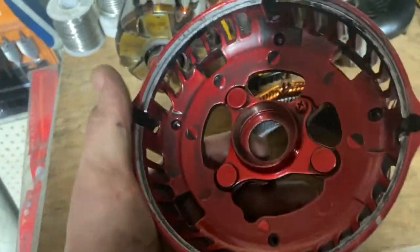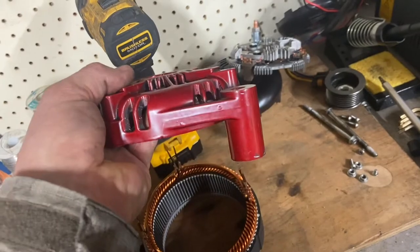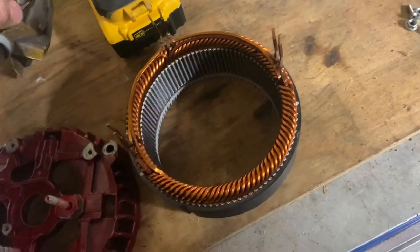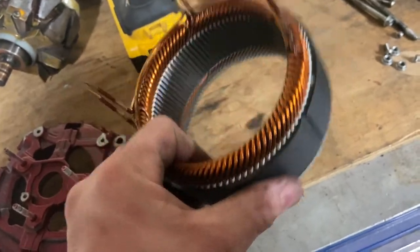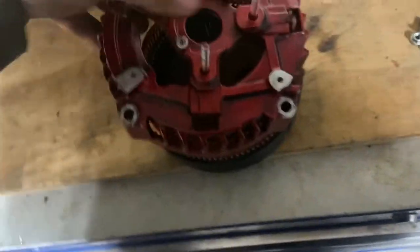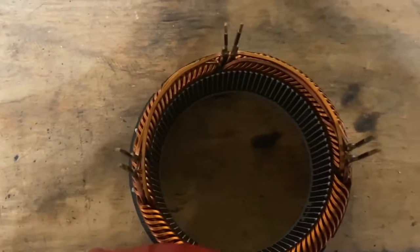The only thing connecting your ground to the front — on most alternators anyway, though some have a mount on the back — is those two little mounts right there on the GM-style housing. What goes through is the case and the four bolts holding everything into the housing and stator casing. So it's real important that you get those cleaned up real good. You'll notice you have three square holes, three sets of leads coming through.